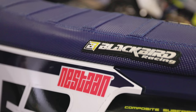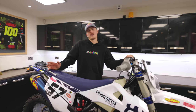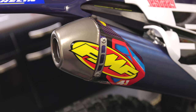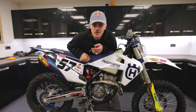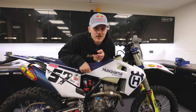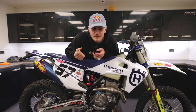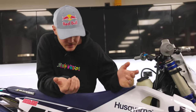This is actually the wrong seat but it's blue so I put it on the bike. For Super Enduro I use a 20mm higher seat - for Super Enduro and normal Enduro I use the taller one; for Hard Enduro I use the stock seat. FMF front pipe and silencer, full system, short front pipe because the power needs to be really fast delivery, and no baffle in the silencer so you have a nice loud noise. Back crackles when you shut off - that's the main reason, but I do actually prefer it out. If the track's super wet and slippy sometimes I'll put it in to smooth the power off a little bit, but I like my power really hard-hitting and aggressive so I can ride aggressively - if I want to do a last-minute splat or move about the track, I like the power to arrive pretty instantly. It means you've got to be quite smooth and delicate with the clutch, but obviously I'm a trials rider so I can manage with that.